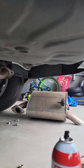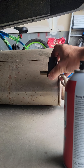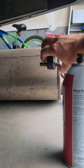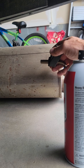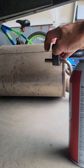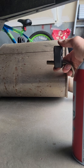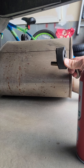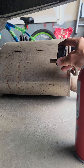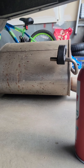I've got the other one dropped off. I left these ones on to show you — they're identical. You can spray both; spray the flanged tip piece on there and then you'll be able to just push that right off with your finger. You can slide these off when you need to, because you'll need to install them on the new muffler — you reuse your rubber hanger. This part took me about eight or nine minutes.